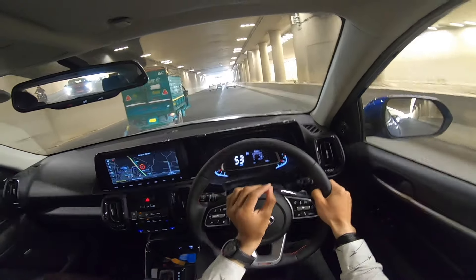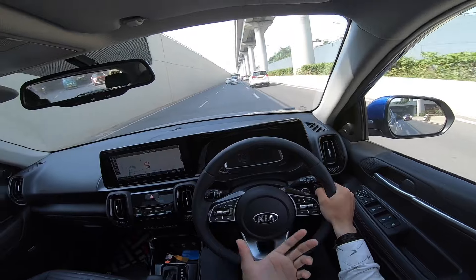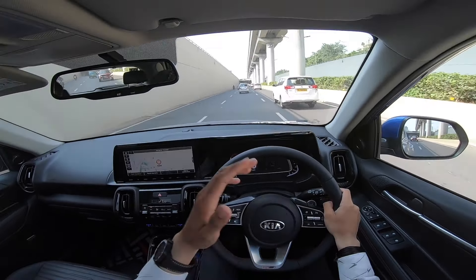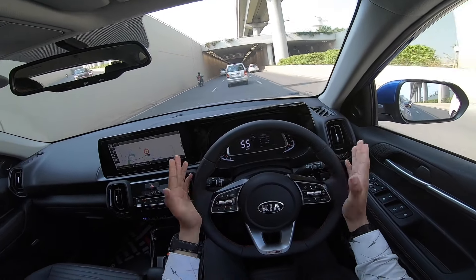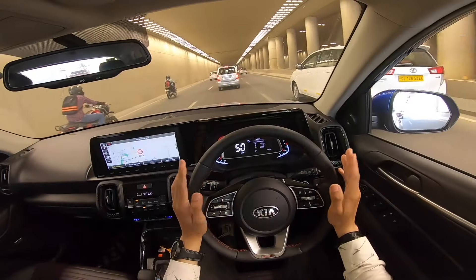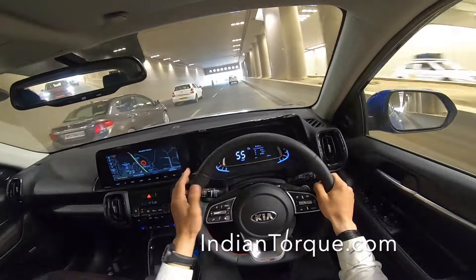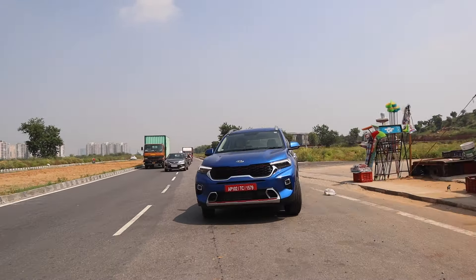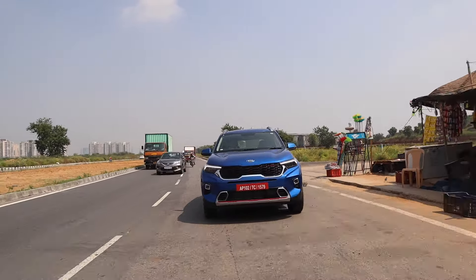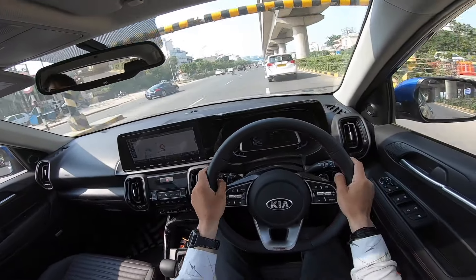That was my first impression. I tested this car in a rough and tough manner to learn everything about it, and I only had it for about 7 hours. I will share a detailed review later when I get it for a longer time. For city mileage, you can expect around 10 to 12 km/l with this gearbox. If you drive economically at 60-80 km/h, you can easily get above 15 km/l. If that mileage is manageable for you and you want performance, this engine is a good pick. Sports mode is also available, where you get higher RPMs during automatic gear changes. Please like and share the video, subscribe to the channel, and press the bell icon. Drive safe, guys!